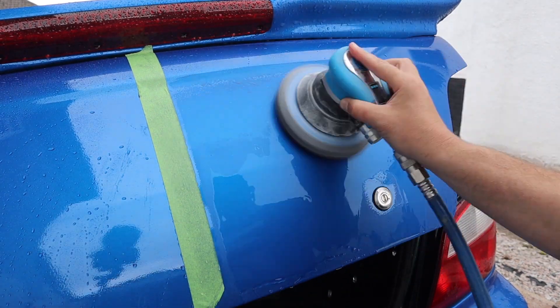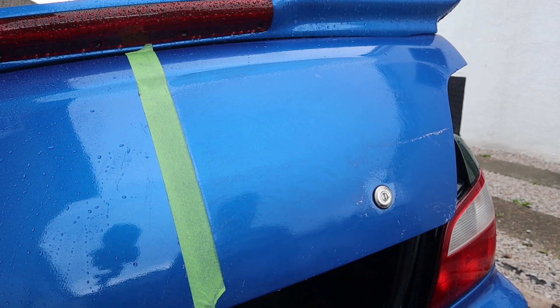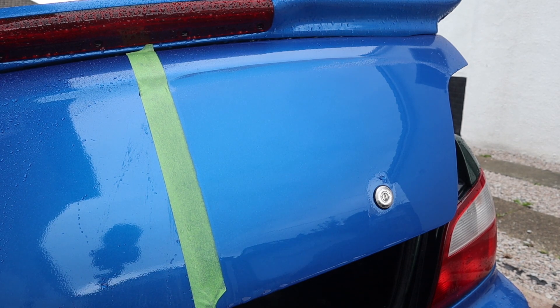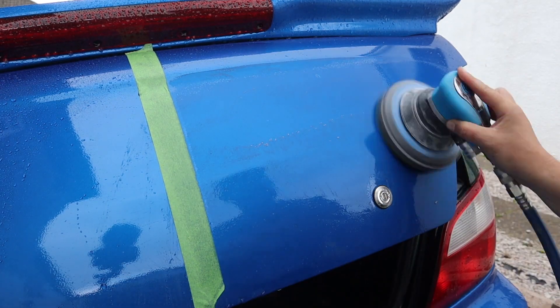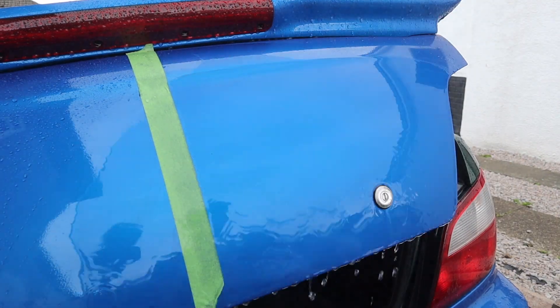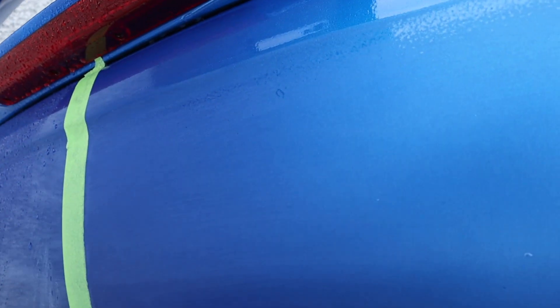On the second pass at 2000 grit I'm not going to stop and assess between sections - I'm just going to wash it off and go straight back in with 3000 grit for two passes, then we can have a look at how flat and good we're looking before starting to polish. After hitting it with the 2000 and then the 3000, the panel is looking probably about as flat as I would be able to get it. Comparing the shiny side to the flat side, next phase is to start polishing that back up to get a bit of shine again.